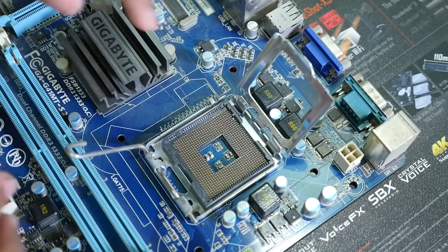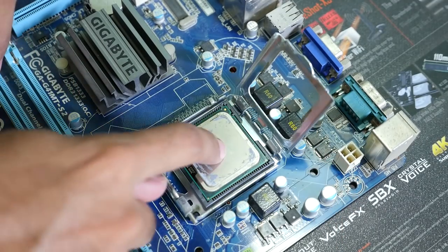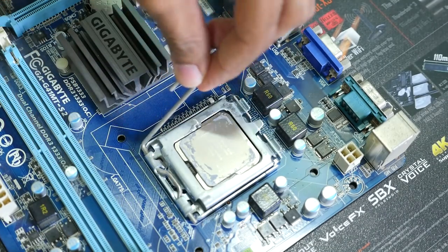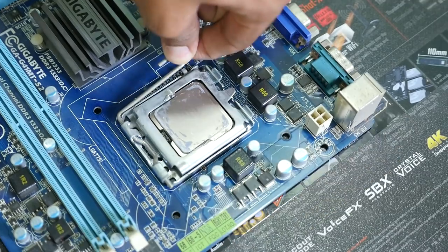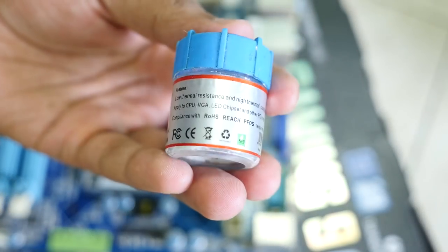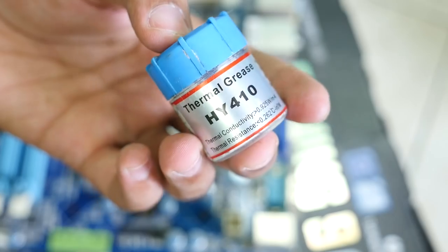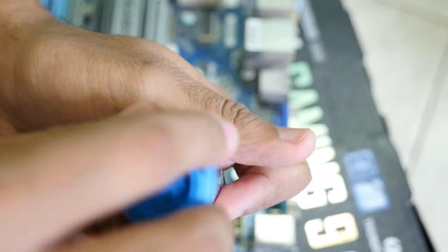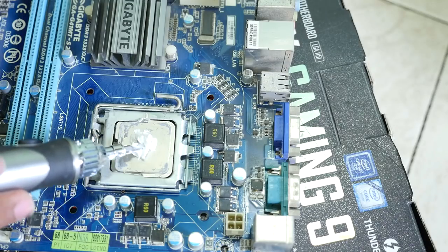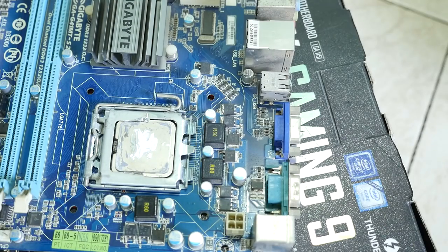Remove the clip, put the processor in place — the two markings on the socket will help you recognize how to align the CPU correctly. If you took a picture earlier, use that. Be careful because the CPU is one of the costliest parts in any build. Now we need to apply the thermal paste. For best thermal performance you should replace the thermal paste once a year or two. I will give a direct link to some good thermal paste on Amazon in the description box below. Apply the thermal paste — a little goes a long way; even a small amount is completely fine and will keep the CPU cool.